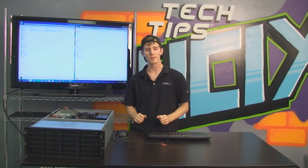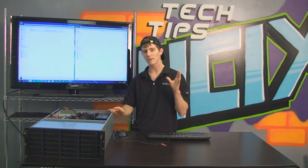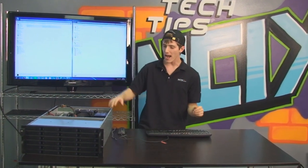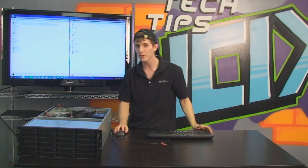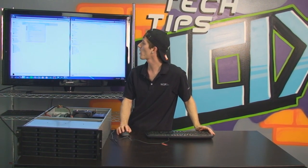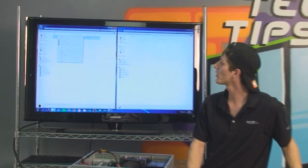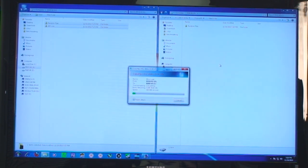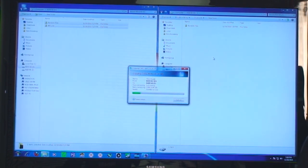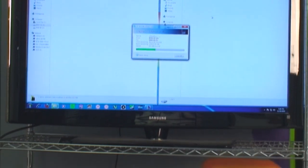For my first experiment of the night, I am going to demonstrate what a RAID 60 can do for you. I have two giant RAID 6 arrays — that means either of these two 12-drive arrays can afford to lose two of its drives. So I can actually lose a total of four drives from my array to physical failure in the middle of a file transfer. I'm going to copy about nine gigs of files over to my RAID 60 right now. It's copying at about 300 megabytes per second. I'm going to come around to the front of my RAID box and pull out some drives.